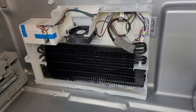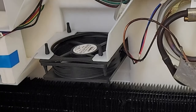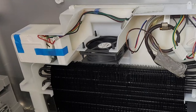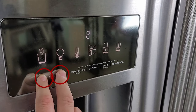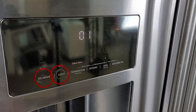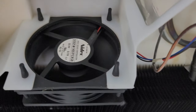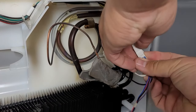The first thing to check is the fan to ensure that it is running. So far I have yet to actually unplug the refrigerator, and the fan is running just fine. However, if your fan is not running, it's a major concern because airflow is coming from the freezer up during the defrost cycle to bring warm air in, and if the fan doesn't work, the coils will not heat up to defrost them. To force the fan on, press the left two buttons on your door's interface and hold for 3 seconds. Then press the 5th button and cycle up until you get to option number 3, which deals with the evaporator fan. Press the 3rd button once to shift fan modes and see if the fan comes on at all. If it doesn't, the fan likely needs to be replaced.